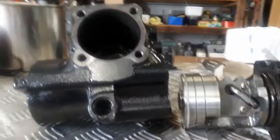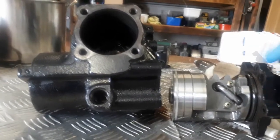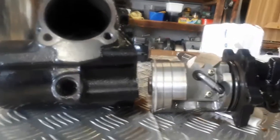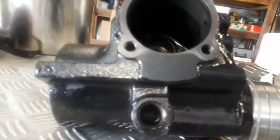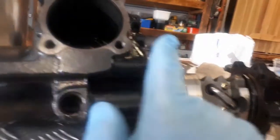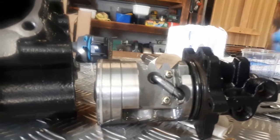Right, okie dokie. So a lot of people freak out. They undo these 4 bolts for the piston assembly and ball bearings fall out everywhere. As you can see, mine haven't. All you've got to do is remove the lock plunger, which is this little gadget down there. Wind the piston, this one, so it goes all the way as far as it can go over here. Then pull this out in one piece.